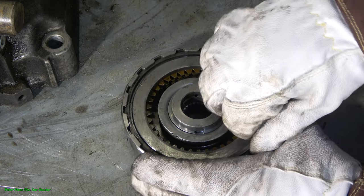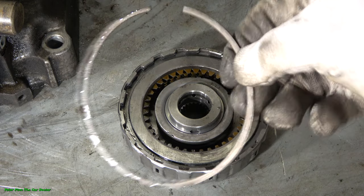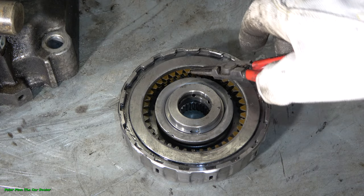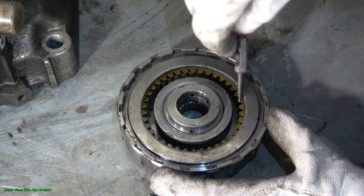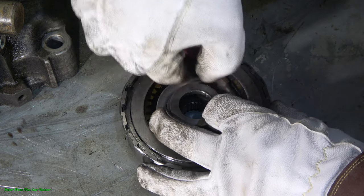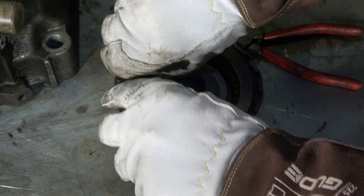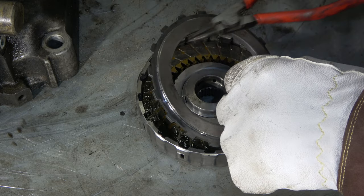And in this position, now the lock pin is away. And this is really a compression thing. And now we have our clutch plates in here. And when I carefully lift that, I can take this next package out. And there are steel plates. This is quite dark and tight. It doesn't go easily. Now it comes out.